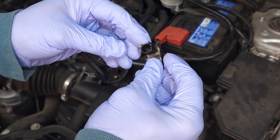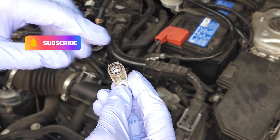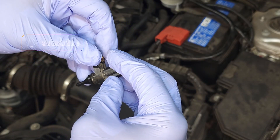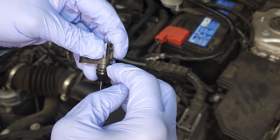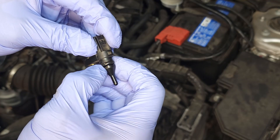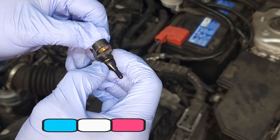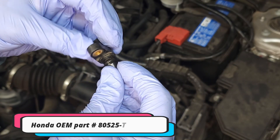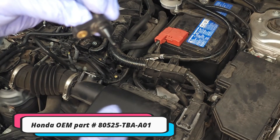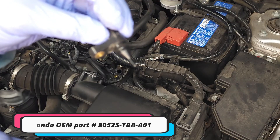Let's go ahead and take a look — do a top-down inspection. You have two electrical connectors. You don't see any cracks here. Above the O-ring there's no oil; it's completely dry, which is exactly what you want to see. There's an O-ring in place — use your fingernail to tell whether or not it's fragile. This one's not. This tip here is really clean, which indicates the environment inside the air intake is very clean, and that's exactly what you want.